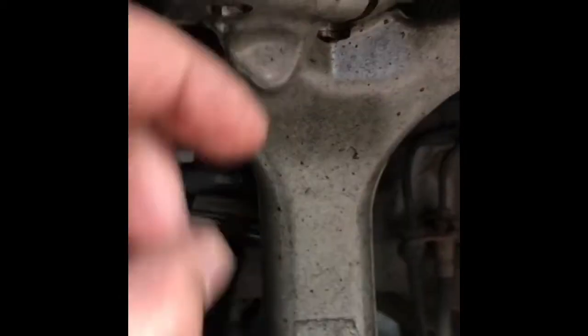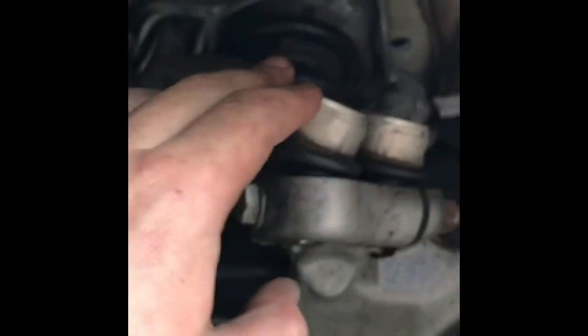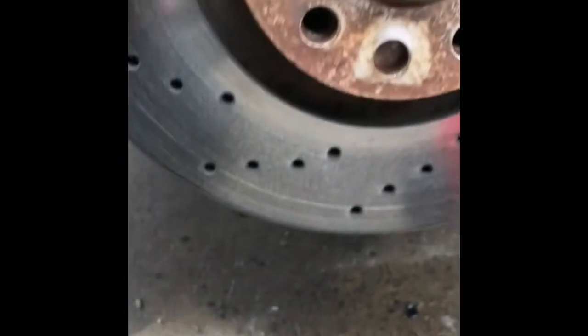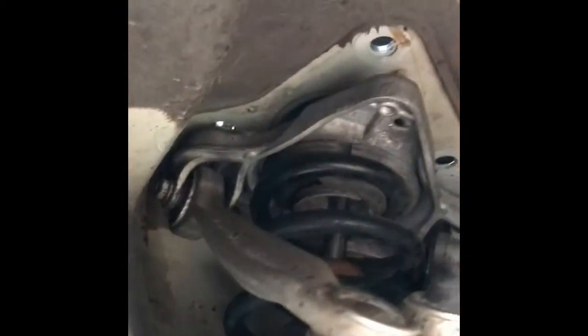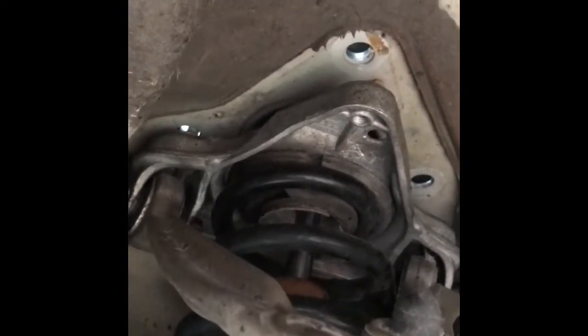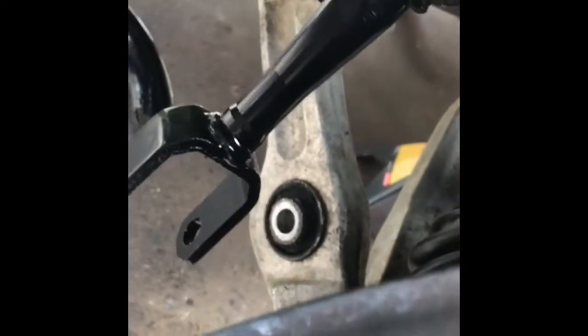On the reinstall, what we had to do was take one bolt. I used the floor jack while Scott picked up the whole assembly, then used the upper control arm to get everything in place and really muscled on it. While I put the jack underneath and supported it and raised it up at the same time, he guided it up in there. While it was close, we stuck one bolt on the side, and that still gives us the space we need to get the lower fork in on the arm.